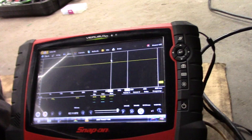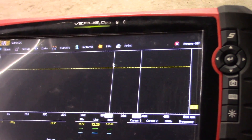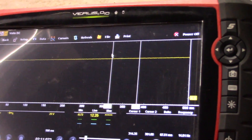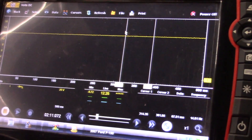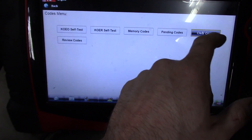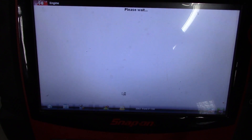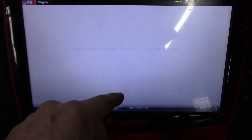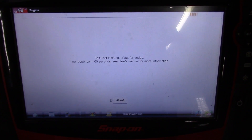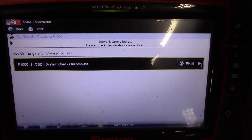Still on my control wire at the solenoid, just wiggling this butt connector around. That's a good connection. I'm going to take this harness back up and clear the faults. We are going to clear our codes right now — codes cleared. Key on, key on engine off test. P1000 — that means we just cleared codes.